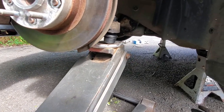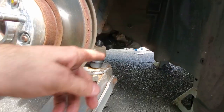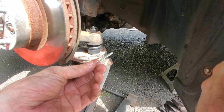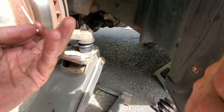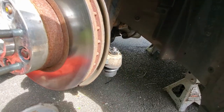Now I'm just going to use my jack to apply some pressure to the outer — just enough pressure where I see the coilover kind of activate — and then tighten this down. Once that's done and tightened up, all you're going to do is put your cotter pin through, lock it down, and the job's complete for the inner and outer.